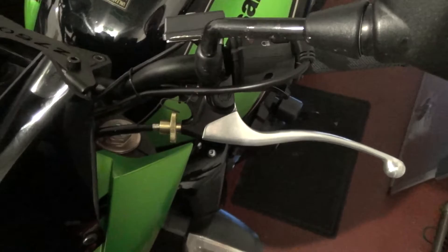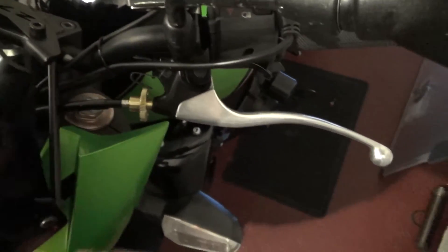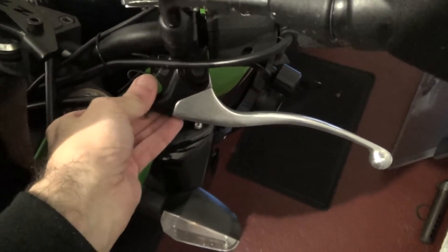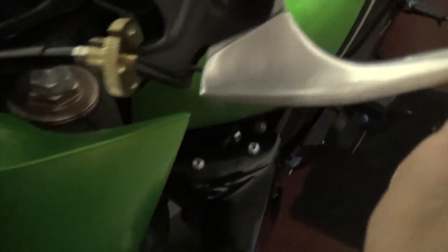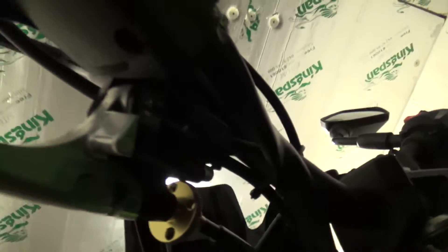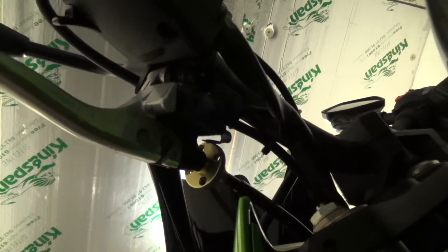The first thing I'm going to do is loosen off the cable. I've seen some videos where people don't do it and some where people do — it looks easier when it's loosened off, so let's give it a loosen. Get a bit of free play in there, because this cable is going to have to come out of that lever. And then we've got a similar arrangement — there's a bolt hidden away in there, that looks like a real pain to get to. It's a 10mm bolt, so I'll get to that with a spanner and see how I get on.